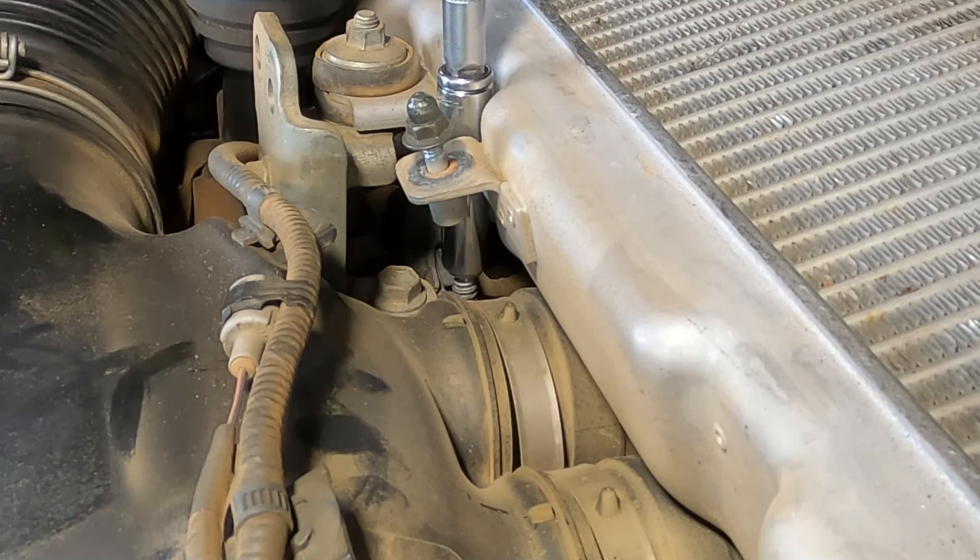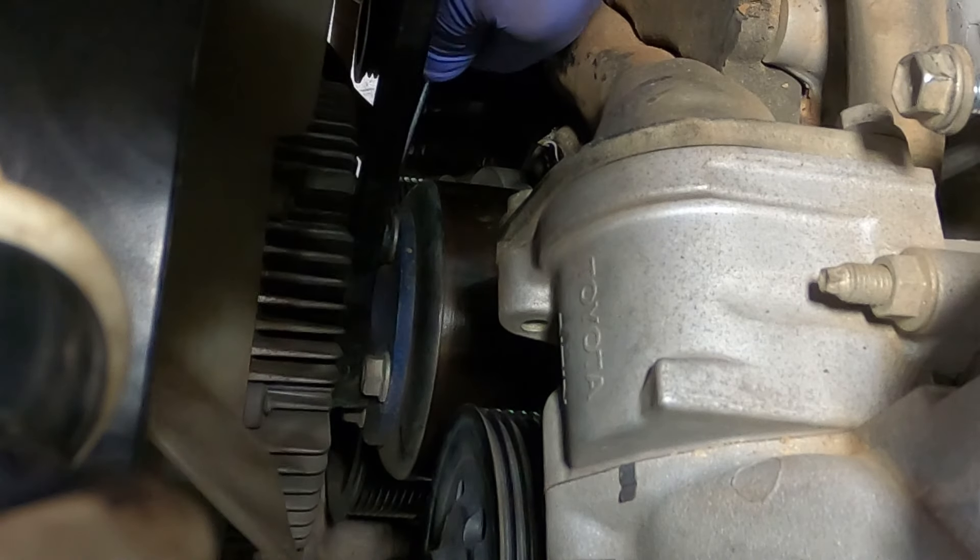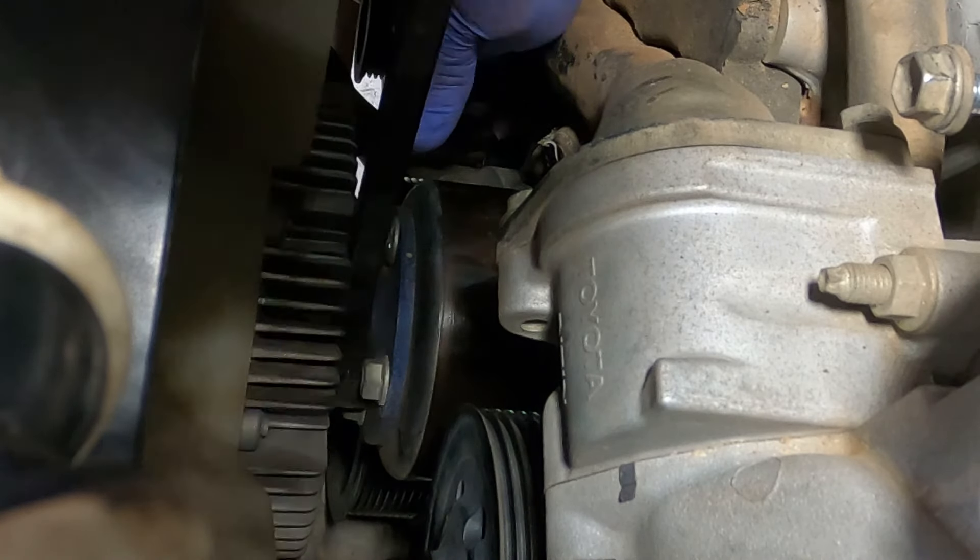Set the intake pipe out of the road and pop a couple of rags in the intake pipes. The last item to take off is the fan hub, because in behind this pulley is one of the bolts to the water pump and you'll never get it off without pulling that off. To get these off, jam some sort of a lever in between the bolts and the hub, get your spanner on there, and simply crack them.